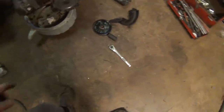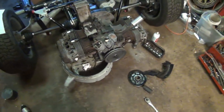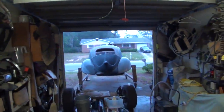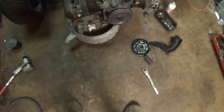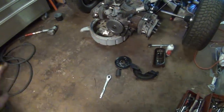This foundation in here, the floor of the garage, is actually wet. And the reason why it's wet is because the humidity is coming up even higher yet. So high, in fact, that it's 70 degrees out and there's a fog falling upon us. But the pavement is much cooler than that because we had last night's cool air here in the garage. And what happens is that moisture will condense all over everything and make this a wet mess. And I'm not excited about that. I hate that because this will start turning into puddles before you know it.